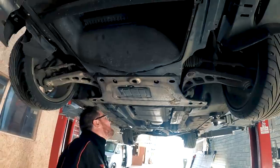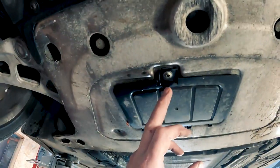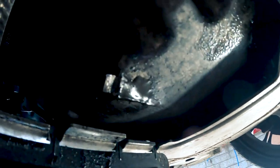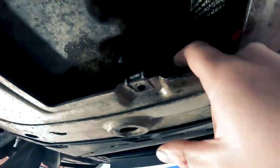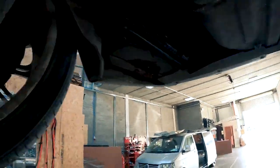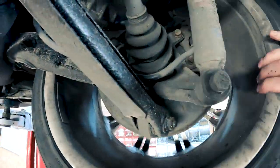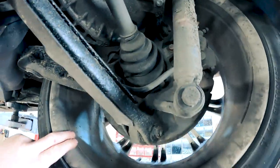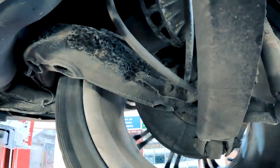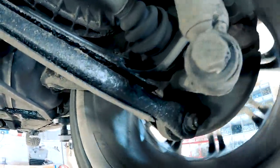Car's on the ramp. I've noticed a few things - I can see a bit of oil here. I'm going to guess there's a leak somewhere. It looks like someone was here before and used some sort of chemical gasket seal - there's a leak there, it's quite wet. Trying to figure out where that's coming from. Across the back, the handbrake issue - this wheel is quite stiff. There's an indicator problem, and some sort of issue that sounds like a speed sensor that could have rusted away, making a bit of noise.